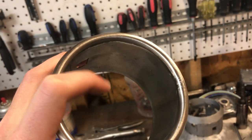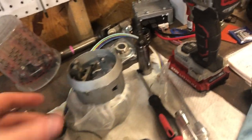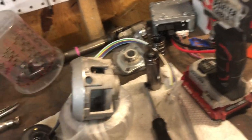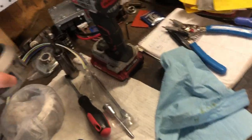This sleeve piece, which is the upper part of the column - unlike the other one I did - it has a piece welded inside and is held in with screws. This piece is rolled over at the top, so it just slips on. There's a little key piece right there; that notch mates up with that notch and it's just a press fit. All I did to get it apart was pop it with the butt of my hand, back and forth, worked my way around it until it knocked loose and wiggled off.